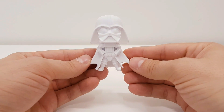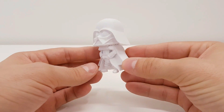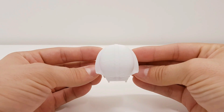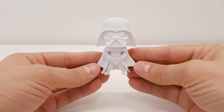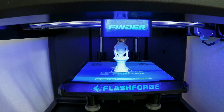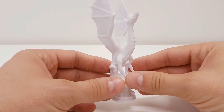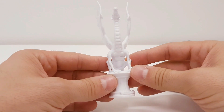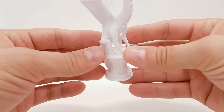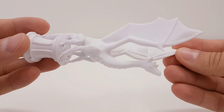After the cleaning, this is the result. This Darth Vader is looking great — printed at 200 degrees PLA using the high profile in FlashPrint. The layer height of this model is 0.14mm, not even 0.1 or 0.08mm which are options for hyper resolution. I think that's overkill — I don't think I will ever print at 0.08mm, there's simply no need. Looking at the next print, also printed with high resolution at 0.14mm, it's really looking great — phenomenal results.